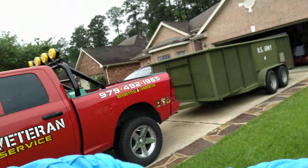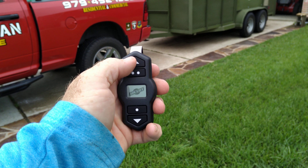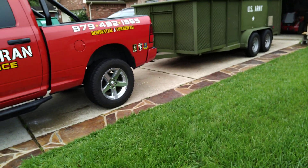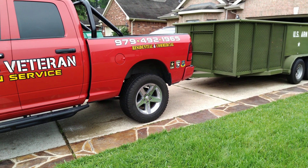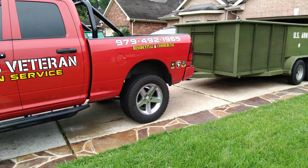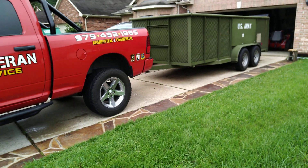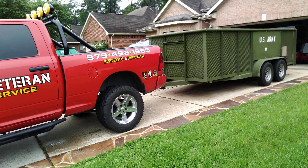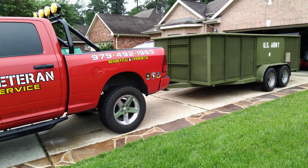This was just a quick introduction to the airbag system. You can air up one PSI at a time. Let's just go to 20, for example. Hear that? It's hard to tell it's raising up but it is raising up — that's 20 PSI. It does have automatic maintenance: whatever PSI you have set, it will add or release to maintain that PSI. So it's automatic leveling to whatever PSI you set, which is pretty cool.